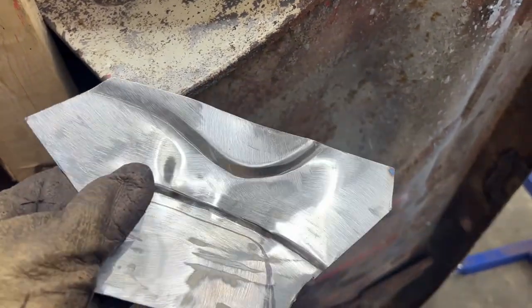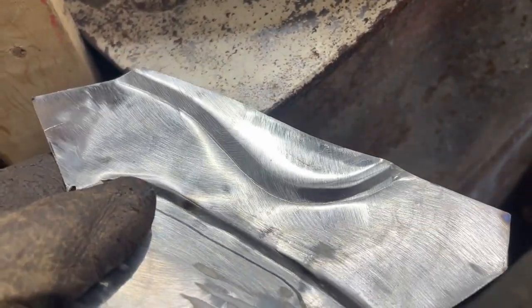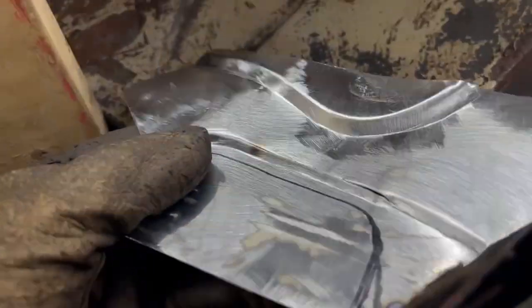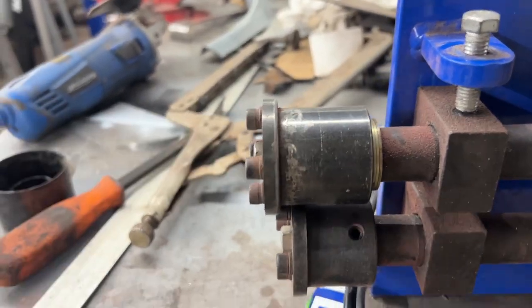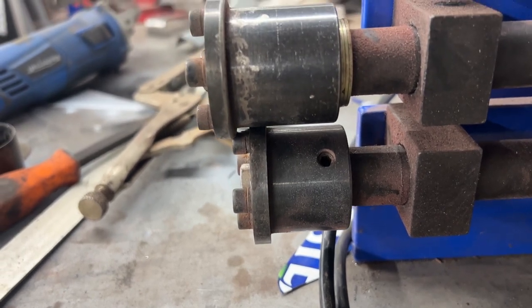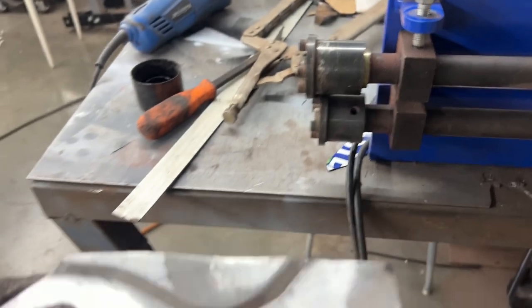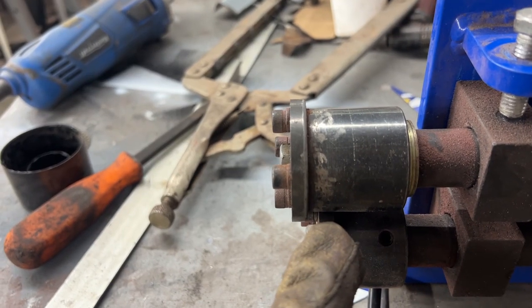This is my test piece from when I was working with my son on his Miata a few days ago. That's how the bead roller is set up, and when I look at it it's pretty close to this curve that we're repairing. I think we're gonna use the same setup and it'll be close enough. These are the wheels I'm using — these are not cutting wheels anymore because I rounded the top one, I need to round the bottom one as well. The way it's set up, the left flange is the one that pushes down, so the left one needs to run right here — I need to mark the line which is made by this edge.